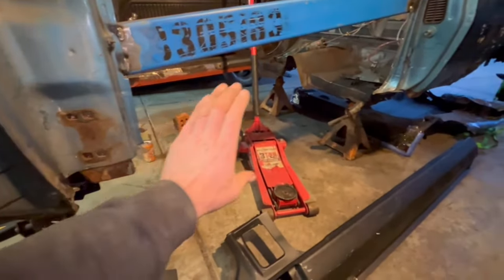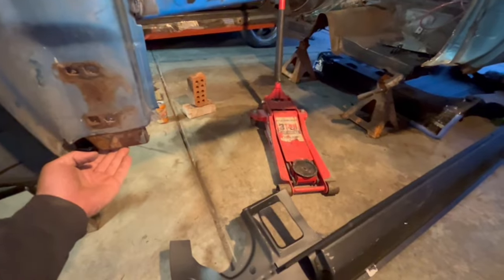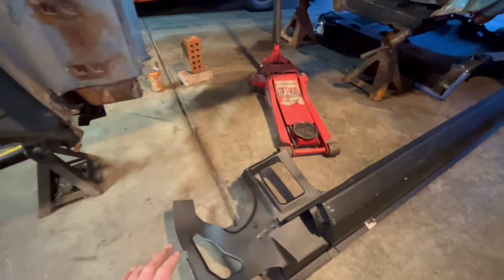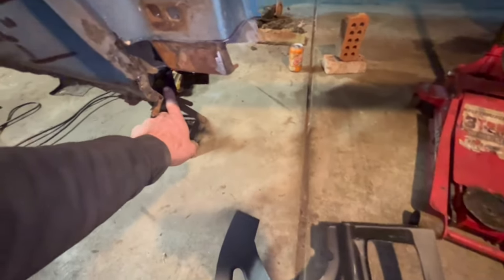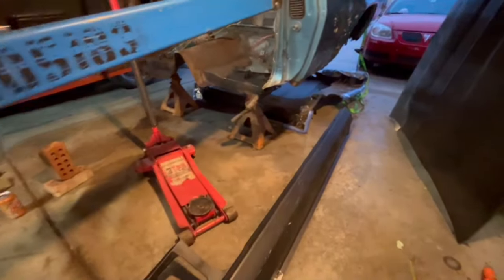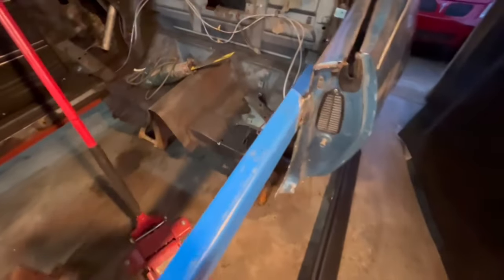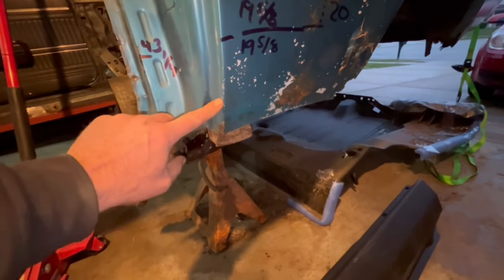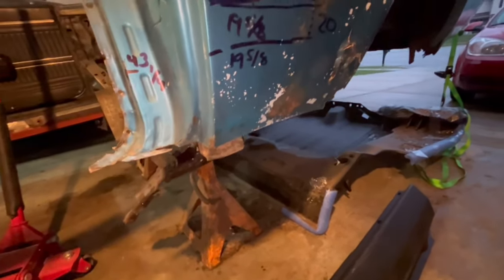We're going to try to get it positioned in the car. Up front, I've got this to tie into — I'm going to cut this off, butt weld all that, and tie a couple little straps on there for additional bracing. Where my toe board is, we've already repaired, it ties in right here. The front has all kinds of places to tie into. The back, not so much — there's no floor pan, nothing. We can tie into the inner quarter panel structure, and that'll give us height and distance. I'll probably add some bracing from the quarter panel down to the rocker panel since we trimmed out about two and a half inches from the bottom.